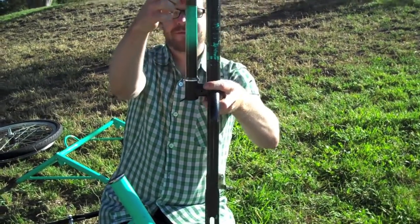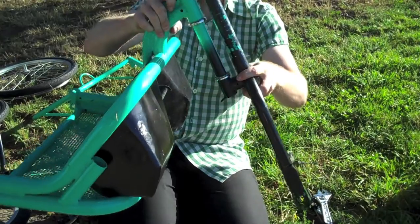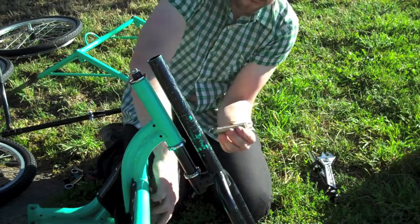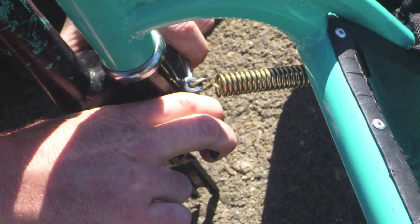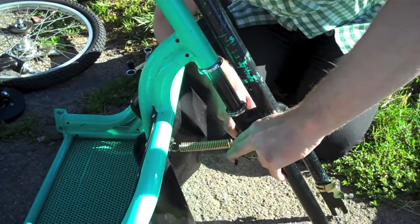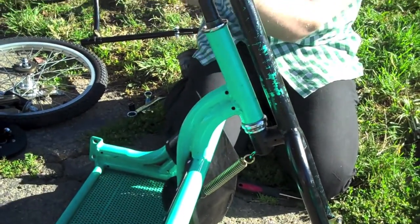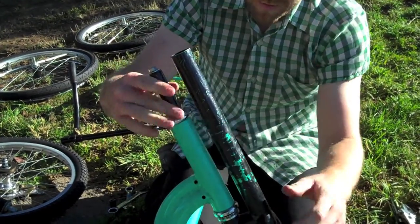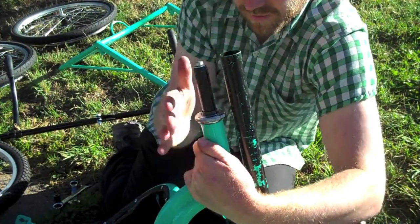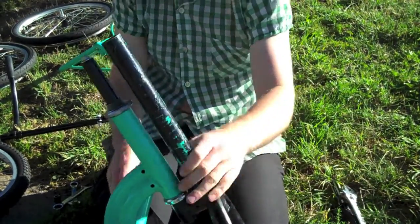This is the front fork — the headset bearings are installed. The bottom set ring of bearings should make sure that the ring is on the bottom so that the bearings can spin freely. Install the fork with bearings and grease, and locate the centering spring before you install the top. You can use a screwdriver to help install the centering spring — it's easiest if you hook it in the orientation shown. The screwdriver helps stretch the spring so that it can be attached. Slide the fork up so that the bearings rest and install the second set of bearings with grease. Make sure that the bearings with the retaining rings are installed correctly such that it spins freely without rubbing on the metal.